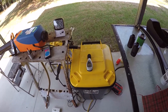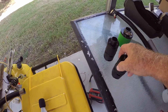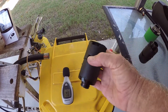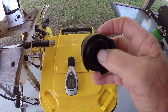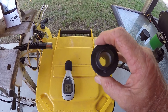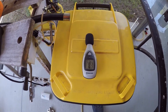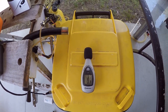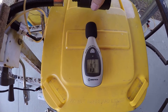In the kit you'll often get one of these intake silencers - not a filter. It has a baffled part where the air comes in and around and down the side, then flows through the middle. Inside there's some foam acting as a noise absorbent. Currently without me talking it's about 73-74 decibels. Let's see what happens when we put the intake silencer in.